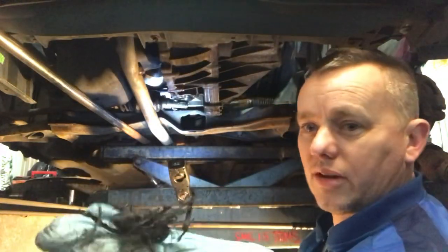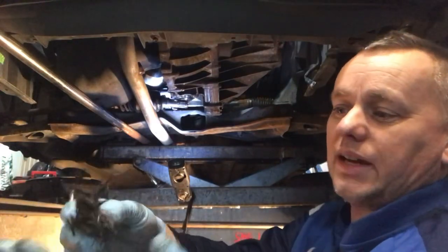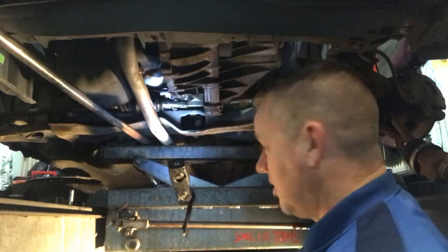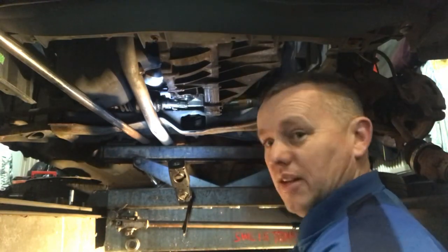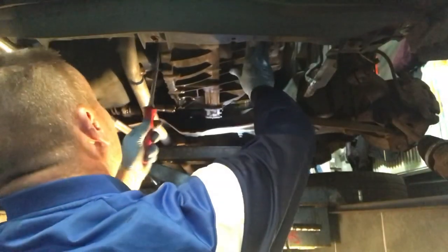I'm looking at this, we've actually got remnants of destroyed clutch plate material. Look at that, it's completely destroyed. It's like a bird's nest. Talk about fried clutch. I'm expecting to see some blue flywheel when we get this out. That's definitely got hot on us. Shake, rattle and roll. Here we go, something's happening.